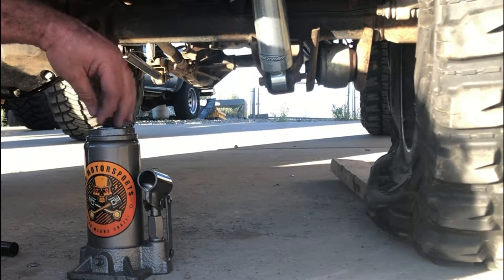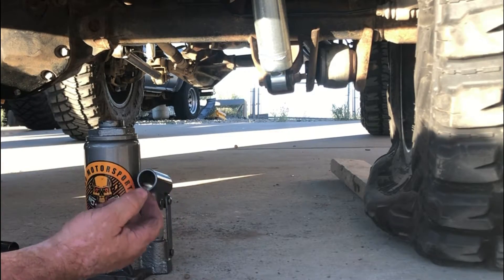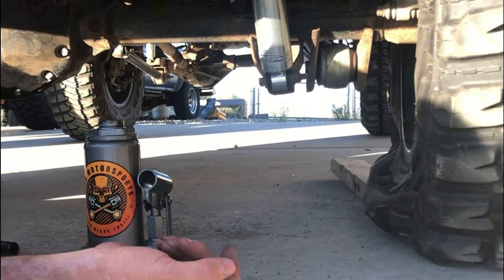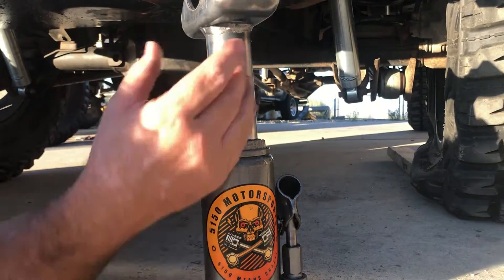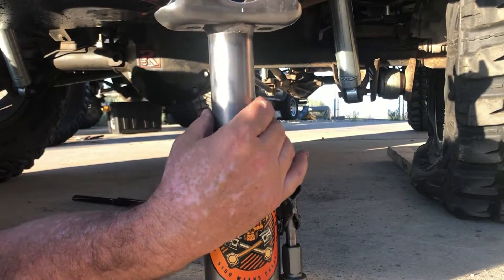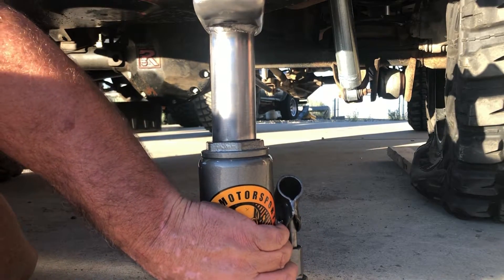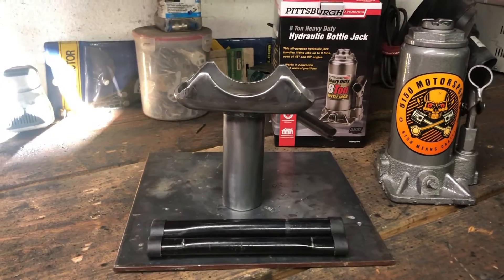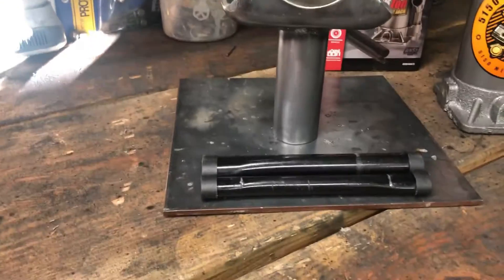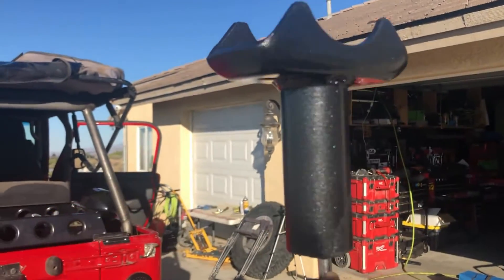The advantage of a bottle jack over a high lift jack: when you have suspension that travels or droops a lot, it's really hard to get the tire off the ground to change it. If you can get underneath the axle like what we just did, you don't have to lift it that high to get the tire off. So again, that's a Harbor Freight jack — that's the piece we just built. It's probably about $15 in material; pretty easy to do. We're also going to make a video about making a base plate on the bottom to make it a little more secure. Thanks for watching — please remember to like, comment, and subscribe. There's everything you need: the bottle jack, the axle adapter. We got it painted; just letting it dry.